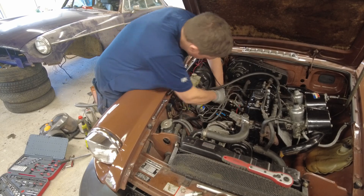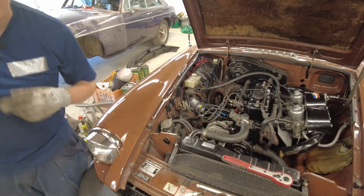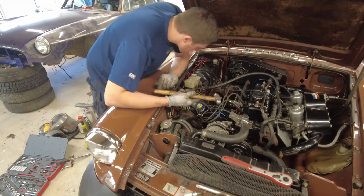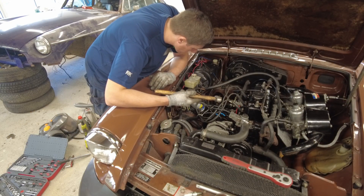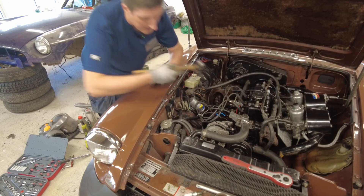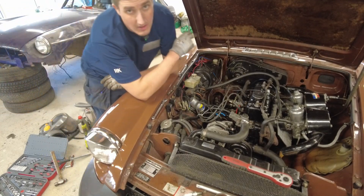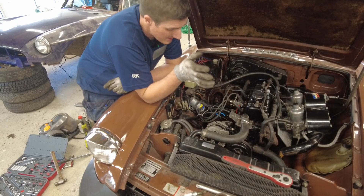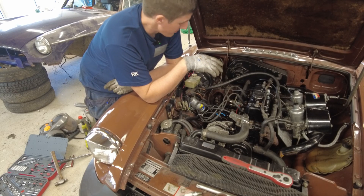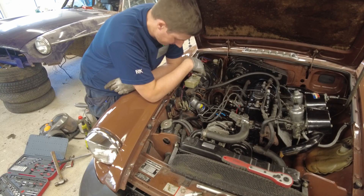There are shims in the steering racks on these, and the shims set the position of the steering column lower part relative to the upper part, so you need to make sure those shims are correct. Anyway the bolts are for the UJ and with a little tap of a hammer you should be able to just slide up the shaft. As I remember from the other car it doesn't go up far enough to clear the steering column completely, so it'll pull out anyway when we let the crossmember down. I know I'm calling it a crossmember or a subframe - it is actually a crossmember not a subframe, but let's not get pedantic. So yeah, that's that done.